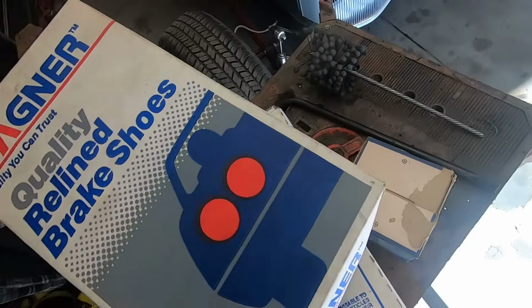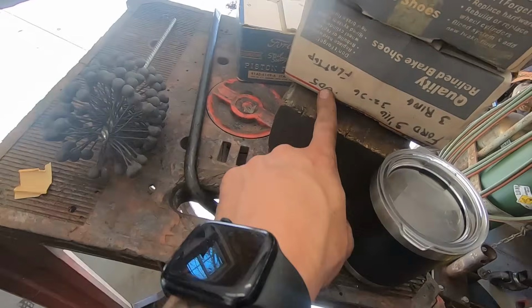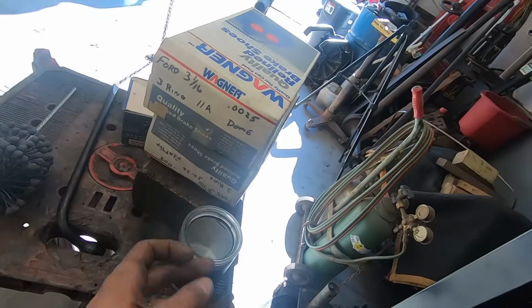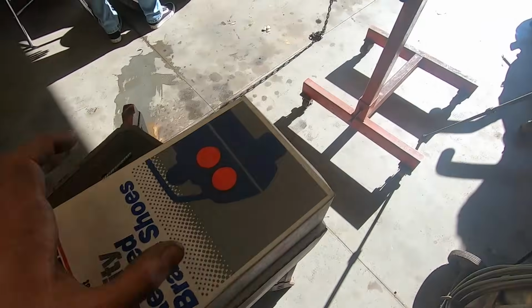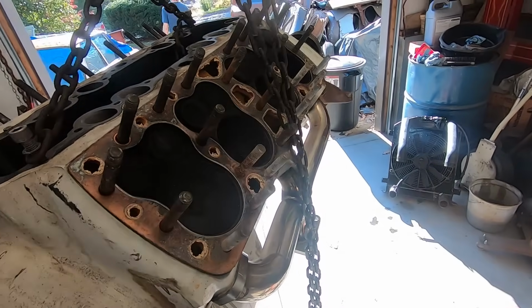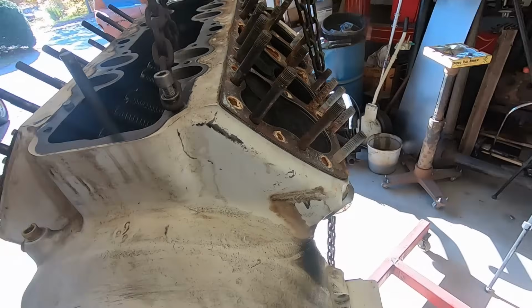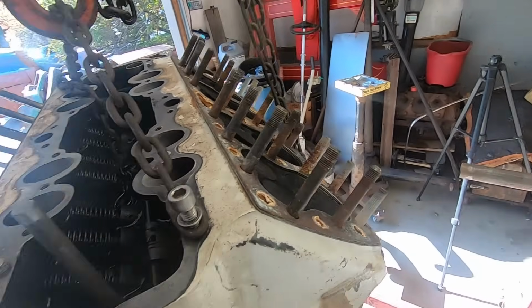So these are the 5 thou over and 2.5 thou over. One's domed like I have now and the other one's flat. I'd rather have the flat set so I don't have to run double gasket and not worried about the heads hitting my pistons. And also, it'll be less compression, and I can run a blower better on it.